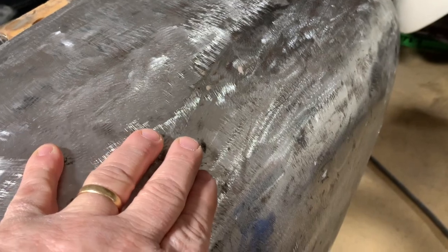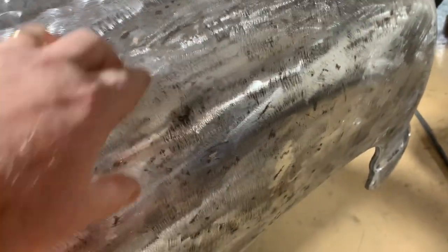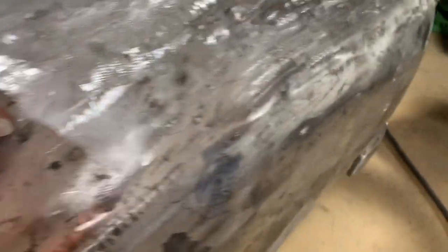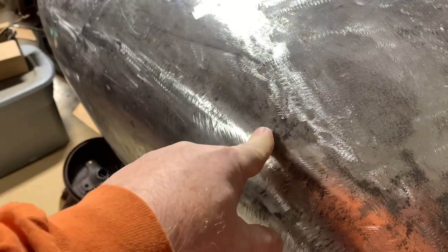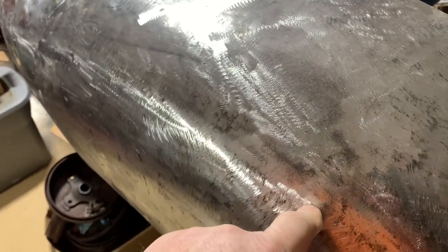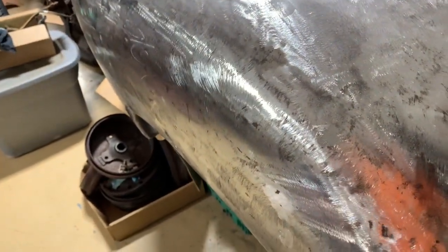It's going to still need body work — I'm not that good and that stuff takes a lot of time. And that's what body filler is for. But at this point, instead of having a half inch worth of body filler on a dent that I've ground off, I've ground off almost three quarters of an inch of body filler off of this fender, along with about 14 coats of paint. You might ask why I didn't buy new fenders. Well, right now, over the last year and a half, about all you can get are fenders that are blems that somebody else couldn't sell — so they probably need more work than this. They might be dent-free, but they fit awful. And I'm sure some of you have been there.